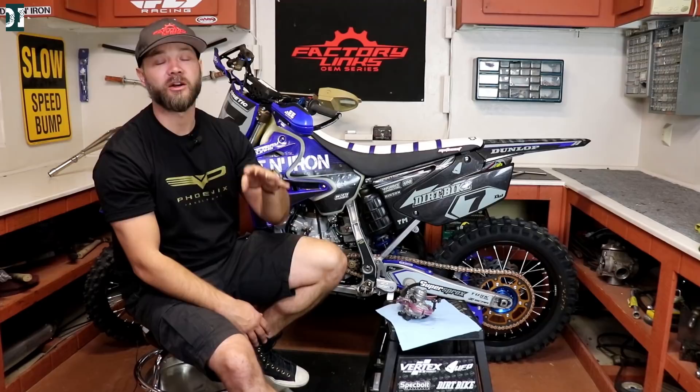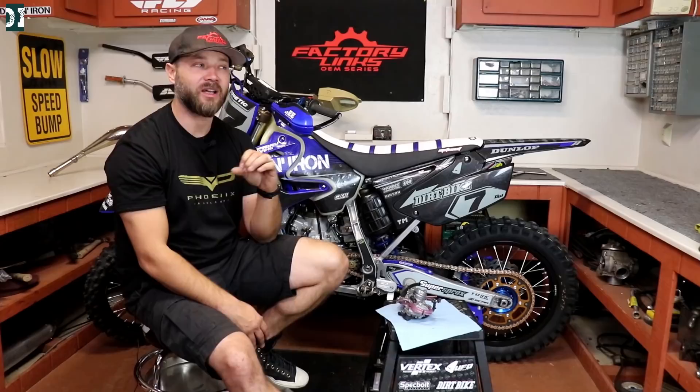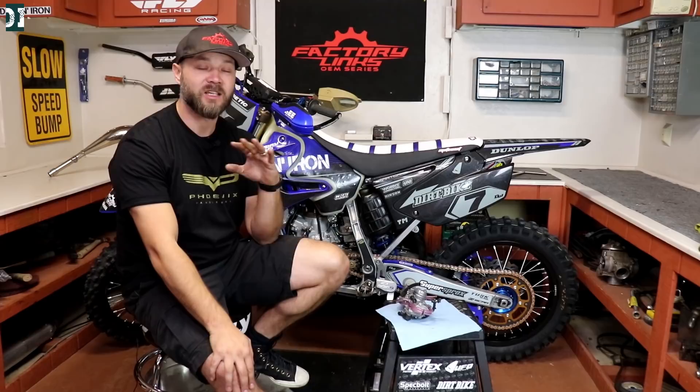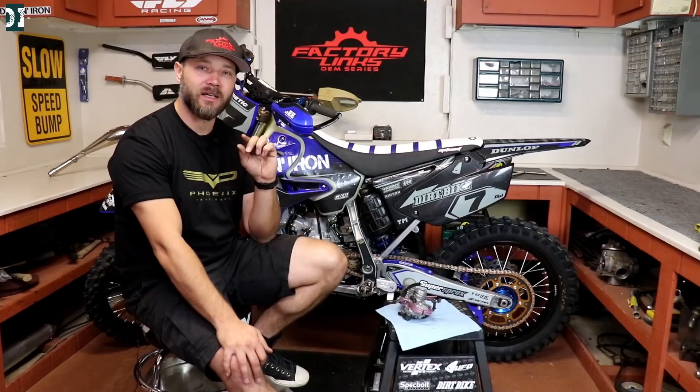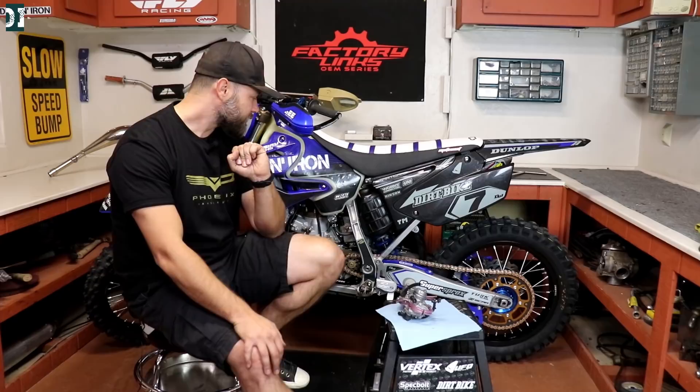After a full day of riding, lugging in first gear, let me show you the exhaust, how it looked. There is a little bit of spooch coming out, but again, it was a two-hour ride and I was going downhill, just idling in first gear, lugging a lot and going off the gas in first and second gear. So I was expecting way more spooch. I'm maybe running just a tiny hair rich on this carburetor and I like it — I want to run exactly that way.